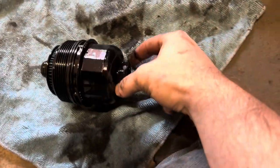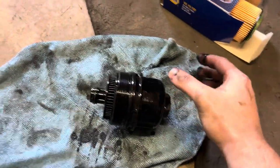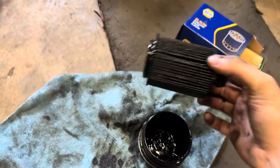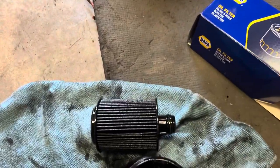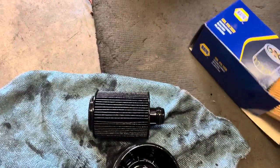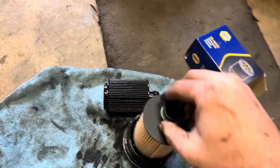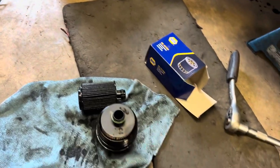Because I'm an idiot, you may have seen that I dropped the filter housing in the oil pan with all the dirty oil - and you actually need this part. So if you do that like I did, pull it back out, take the old filter out, then replace it with the nice new filter. There we go, and then the housing can go back on.